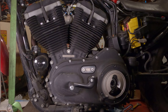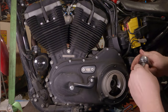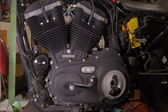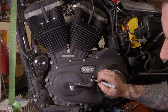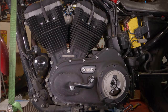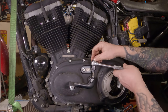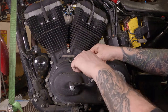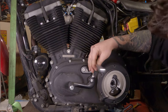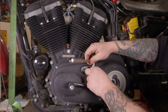To remove your shifter, locate your quarter inch allen wrench or allen socket. Before you take it off, you may want to put a mark on it so you can remember where it was — I'm going to put a mark on here at 12 o'clock. Take this quarter inch allen, break that bolt free, then spin it all the way out of there. You have to take the bolt all the way out to get the shifter off.